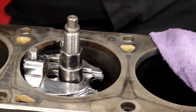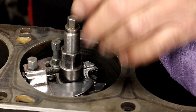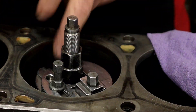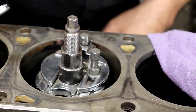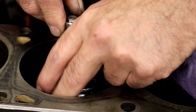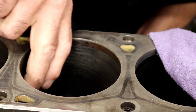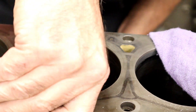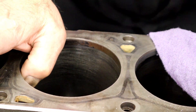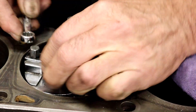Tool in, expand, done. Something happened here — there's a scratch in that cylinder. The ring has left a scratch in the cylinder wall, and my tool caught it. I felt it. There is a little scratch going up the bore. Something got in the cylinder and scratched it. It seems to be okay and it'll be fine, but it did catch, and that was enough for me to stop and say, 'Hey, I feel something really weird — that's not normal.'